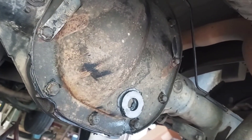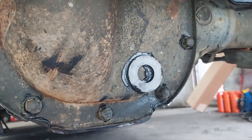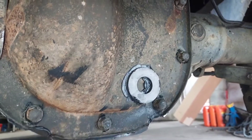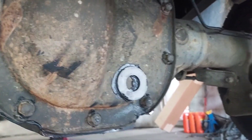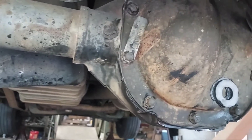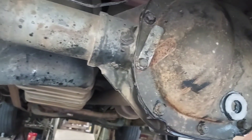Last thing — I've got it topped off with gear oil. I took a little magnet from an old transmission pan and stuck it right there on the differential. It's already got one on the fill plug, but I went ahead and added another. That helps catch any residual metal — I tried to wash the differential out as best I could with brake cleaner, air hose, and rags, but you can't get it all. We'll give it one final wipe down and then go for the test drive. We're back — the truck did great, zero noise. I'll write up the invoice and do a final look underneath to make sure everything is sealed up.